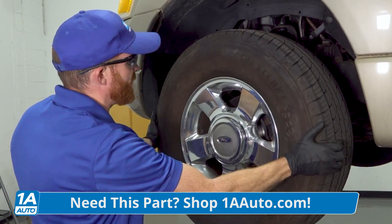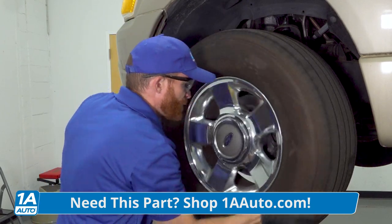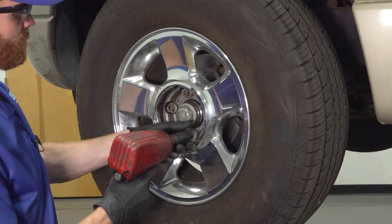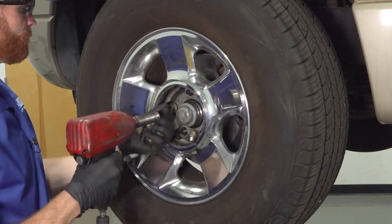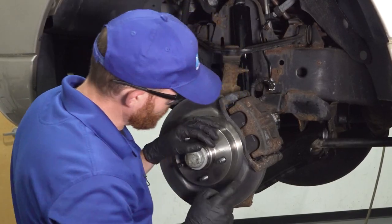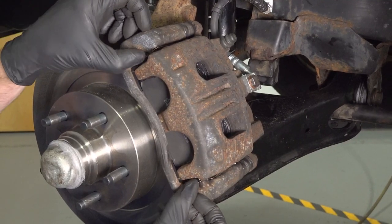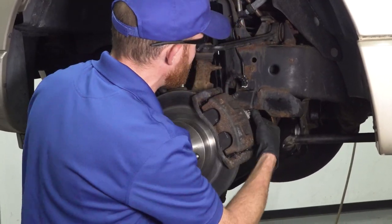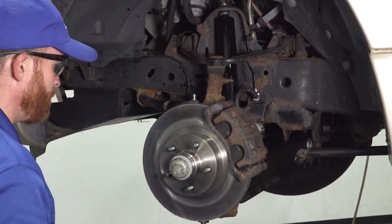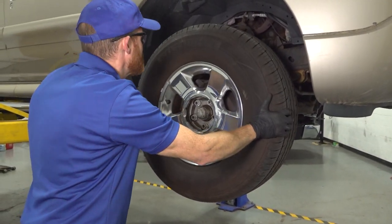While it's up on the lift, we'll check the front end and make sure it's tight. I feel a little bit of wheel bearing movement but it's not very bad. Giving it a spin — that sounds good. I'm going to take off all the wheels so we can get a better look. These brakes look pretty new: rotor, pads, flex hose, and I even see a little bit of lube underneath the tins on the brackets and along the slider pins. Pretty good. They replaced some other front end stuff too. That bearing feels good.